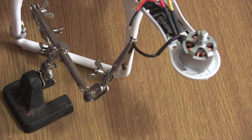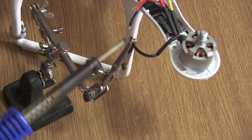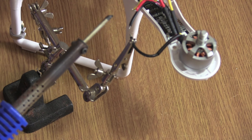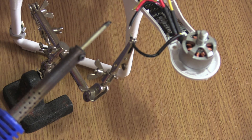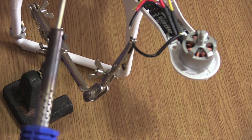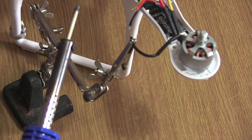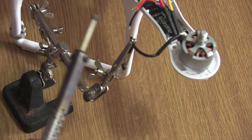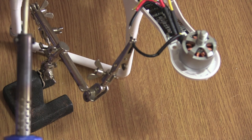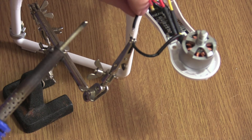For the final stage, I've used my little helping hand here and we're just going to basically solder the cables together — black to black, red to red, yellow to yellow — and we have to do this for each of the motors. Once we've done that, we can pull the heat shrink over and heat it up with a hairdryer or something similar, and that will shrink and keep the connection nice and safe. But before you put the heat shrink on, you actually want to test your motors first. So let's just go ahead and try to make the first connection.